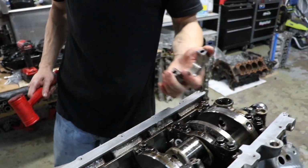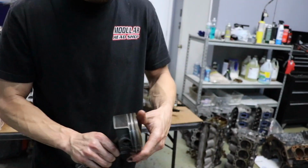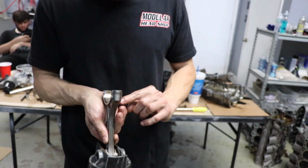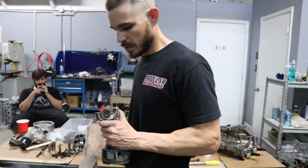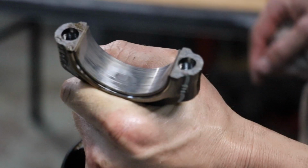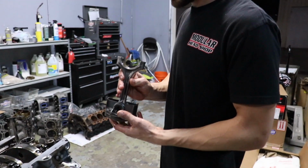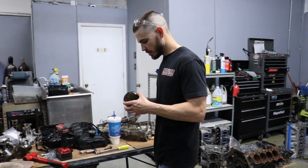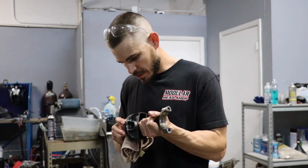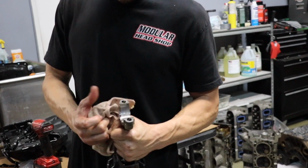I think one of these is the one that I was a little suspicious of. Of the piston, right? Yep. I mean, the rings are... And the skirt. Same thing here, though. Right in the middle. Yeah, you can see that little ghost spot. Hold it a little bit towards me. Yep, I can see it really well now. Same thing, but the rings are good still. I don't really see where the ring land's lifted or anything. Same thing though, the detonation. Worse than the others.